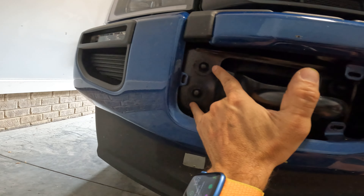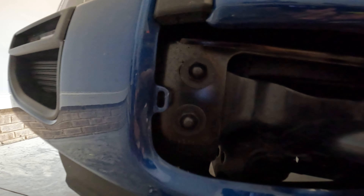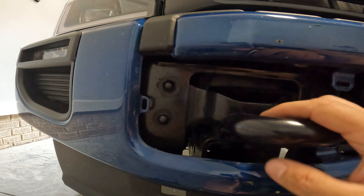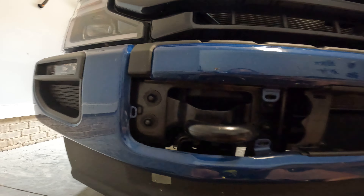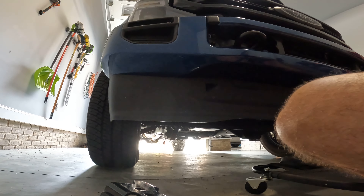You're going to have to mess with these two bolts right here. The directions say they're an 18 millimeter — they are not, on a 2022 at least. They are a 19 millimeter; this is a 17 to 22, so you'll have to try it out. Mine's a 19 millimeter. I'm using an impact — you can use a wrench, whatever makes your life easier. It impacts mine.